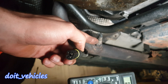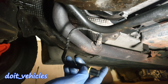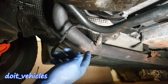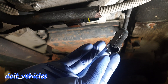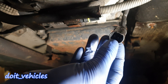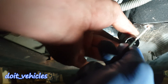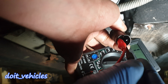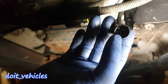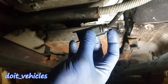These three tests can confirm that you don't need a new oxygen sensor, and you don't even have to remove it from the exhaust pipe to test it. These wires go to the PCM. The only tests I can do here are to check if the wires are shorted to ground or between each other. There shouldn't be continuity between these pins. I'm going to use an alligator clip to catch on one pin, so I can have the free hands required to connect on the other pins. I can now confirm that there is no wiring issue between these four wires.